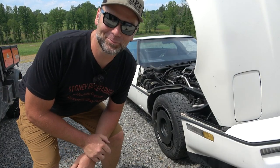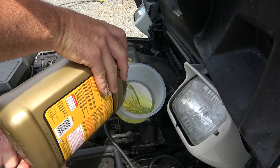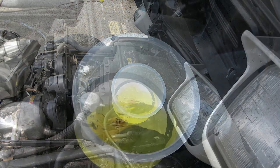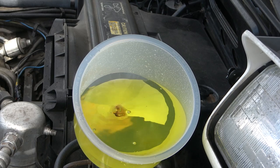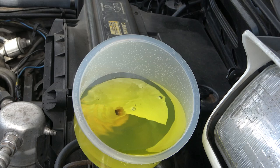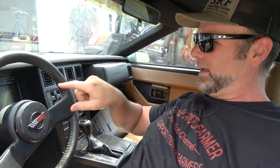I'll bet you never saw a Corvette driving around with the hood up. I'm going to keep adding coolant until it stops bubbling out. We're not making a very big mess, which is pretty awesome. Now you're going to see a change here in a second — at about 195 to 205 degrees, when the thermostat opens, you should start to see more bubbles. You should also see some coolant disappear again or overflow. Inside the car, I have the heater turned on low, so that's not interfering with the cooling, and you'll see our temperature starting to come up. Our thermostat should engage here in just a second.